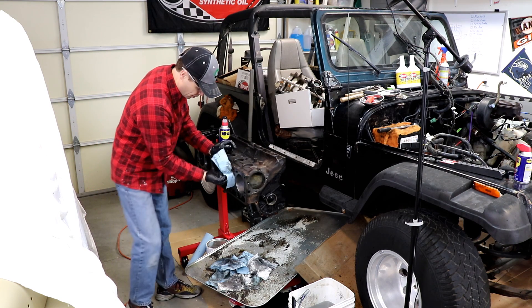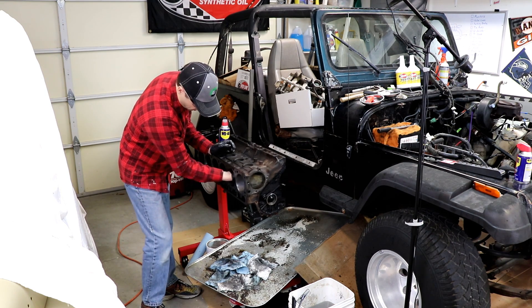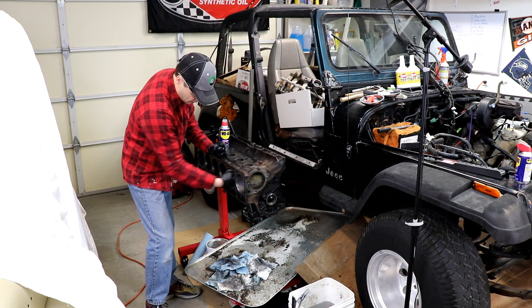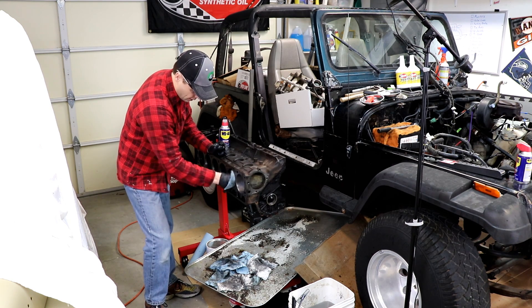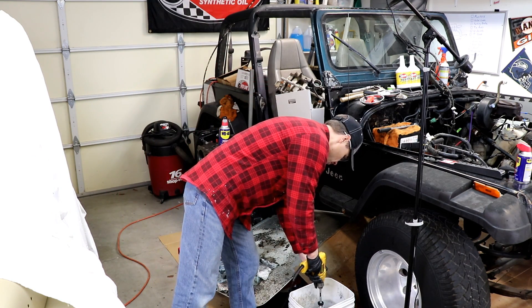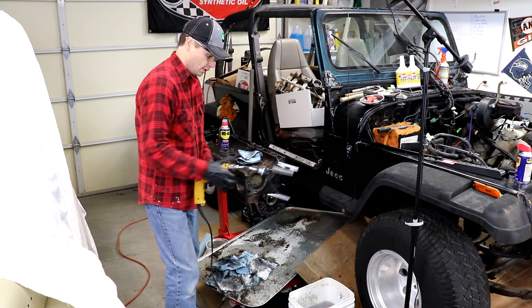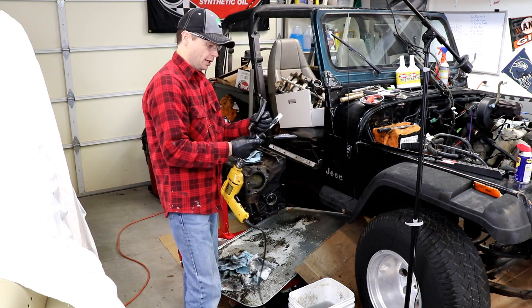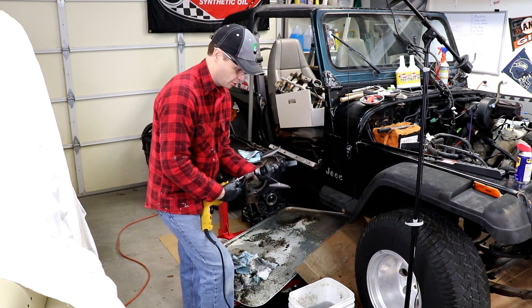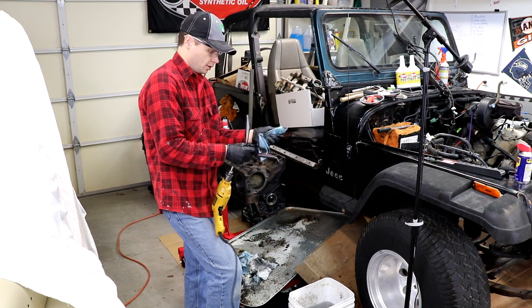So that's kind of what we're doing — just repeating that process. Every once in a while, taking a rag and wiping out the cylinder, getting all the little dirt and gunk. You can see all that gray gunk coming out — that's just some of the glaze and a little bit of the stone, a little bit of dirt, all coming off onto our rag. We take our stones and rinse them with some water. These can kind of build up a little bit of glaze on them as well. You can take a little brush and scrape them off if there's actual glaze built up. Just pat them dry.